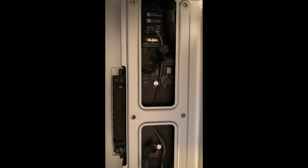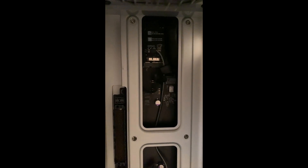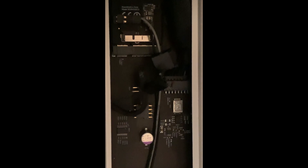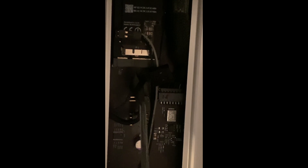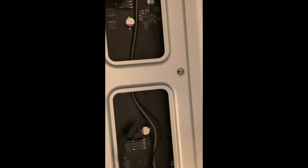A couple of gotchas: on the left side there are two connections — you can see these two right here. They're not super delicate; just use your fingernails to slide them out and they pop right out. You've got to get those out. These are your fan connections, and I believe this one here is a sensor — correct me in the comments. So there's a sensor, a fan, and another fan. When you pull the whole unit out, unscrew everything, take it apart, and disconnect these three connections — and then it still won't come out, and here's why.